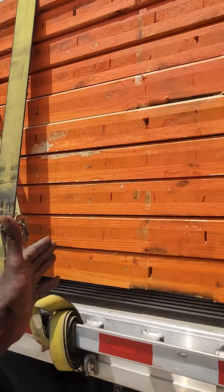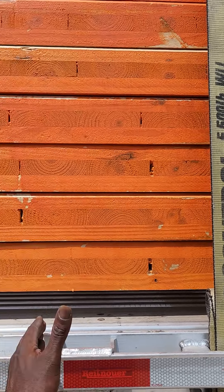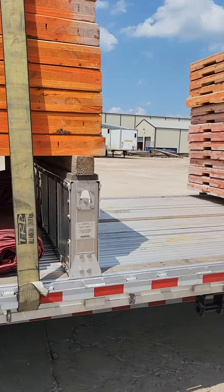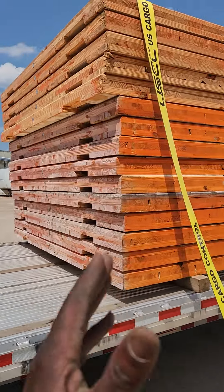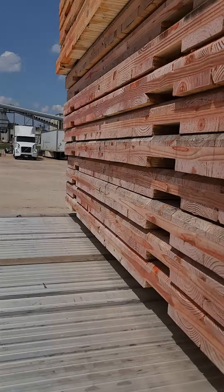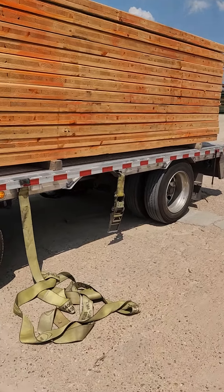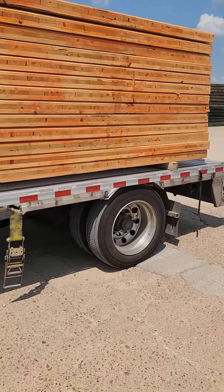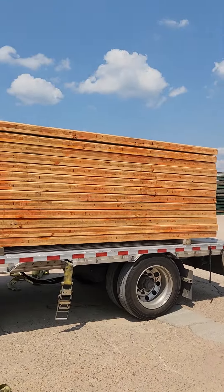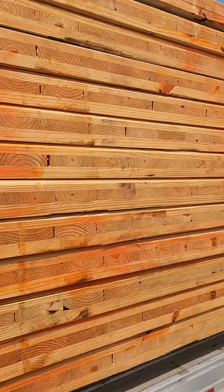Like the front of that should have been situated at least about right here — yeah, about right here. That could have helped a lot on my drives. But now I came back and got this moved from up here somewhere to back there. I got my axles spread — I can handle 40,000 on my trailer with spread axles, as Ben has corrected me before with the Southern grammar thing. I also got this stack moved back further as well.